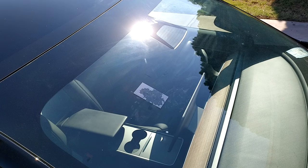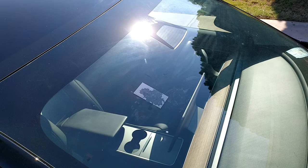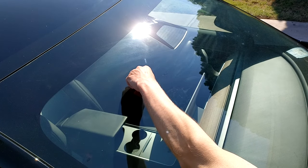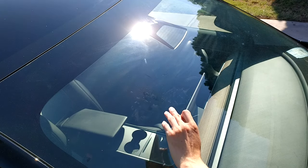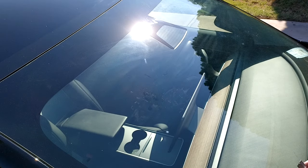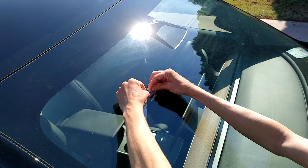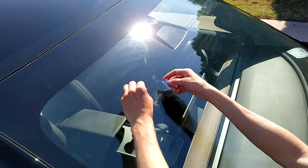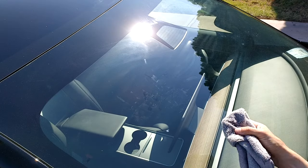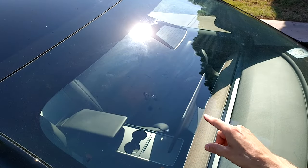It's been in the sun for about ten minutes. I'm going to peel off the plastic piece and use the razor blade to clean up any excess resin. I also have some acetone to wipe over it to remove any final residue. I'm peeling it up — the resin feels dry, not sticky or tacky, which is good. I take the razor and gently clear the whole area, taking care not to dig into the glass too much. Then I wipe down the whole area with acetone to dissolve away any remaining residue.